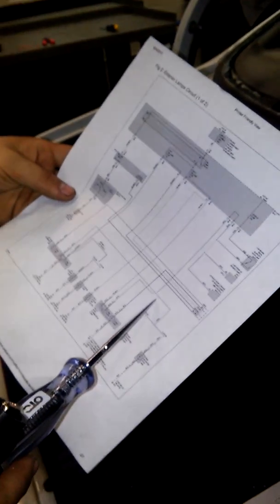Alrighty, now we're already down here at the back of the vehicle. We got our tail light here, and in our diagram we go from brake switch through here down to our brake lights. It shows here with the split how it activates our middle piece here and both sides of the brake light. I'm going to demonstrate for you how they all work. And bam, brake lights on.